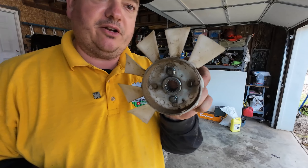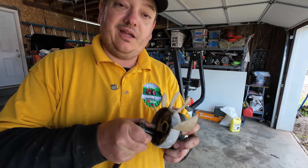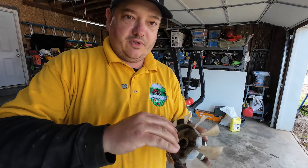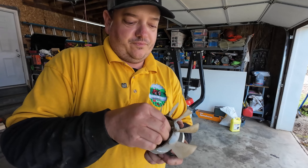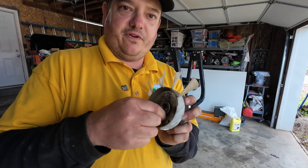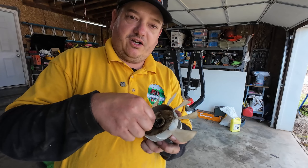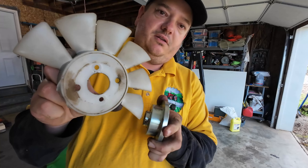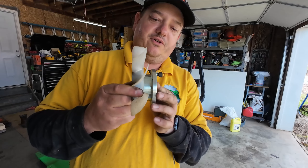It comes off with that metal mount. It's only got two 10 millimeter bolts to take it loose. And I'm shocked — these things are actually pretty loose. It does not feel like they were much more than finger tight. Also notice the orientation of your fan whenever you are pulling this loose so that you can put your new one back on the same way. The flat side of the fan is mounted towards the metal housing or the metal mount.